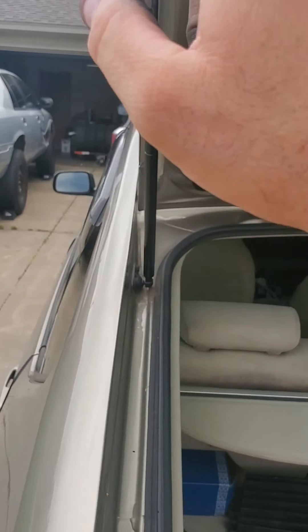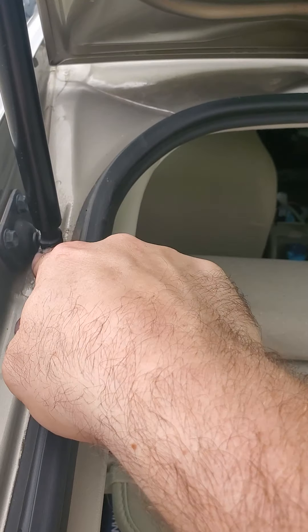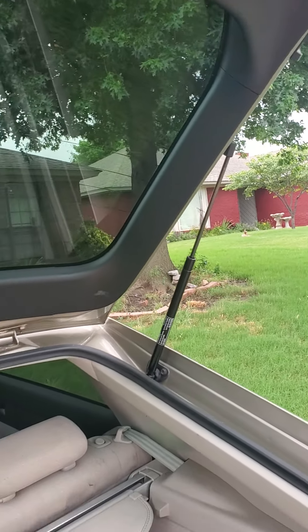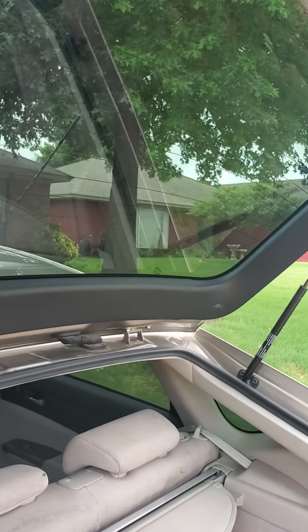Very easy to install. I showed you how to do the one — that's how you do the other. They do have bolts, but these bolts only hold the bracket to the steel that has the ball at the end, so all four connections are exactly the same: one, two, and three, four. It's much easier if you have a friend, or you can let the hatch rest on your shoulder as you're pushing on the new one, because the old one wouldn't hold it up.